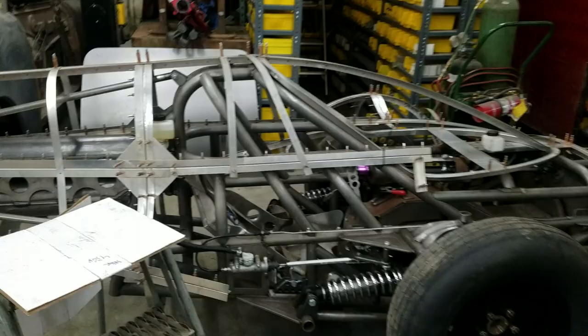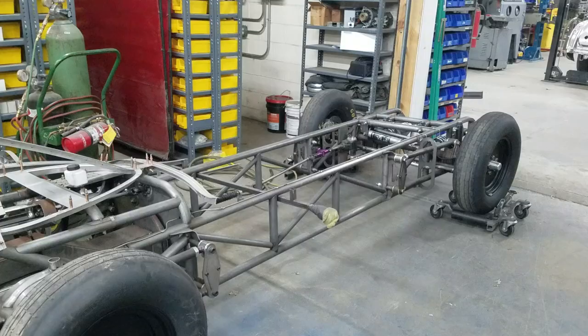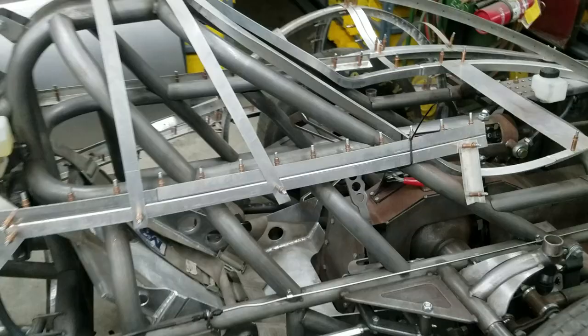This is kind of the back storage room — overflow and quick turnaround. The roof skin shouldn't take super long so I didn't want to move it up front. So this is a land speed streamliner for Bonneville. I'm going for the 176 and some change diesel record at Bonneville. This is pretty much just the skeleton — all the suspension and everything. I'm building the aluminum inner airframe structure and then I'll skin it all once I'm happy with it. Still quite a bit to go — everything's just tacked together, still in the design phase.